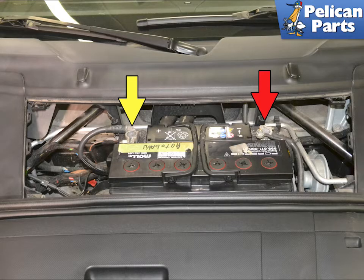If you remove the sensor ring and it moves, or you are installing a new one, you will need to recalibrate it. You're going to be removing the steering wheel airbag to access the steering sensor. Before you begin, disconnect the negative then positive cables from the battery with a 10 millimeter socket and wait at least 20 minutes for the residual energy in the system to dissipate.